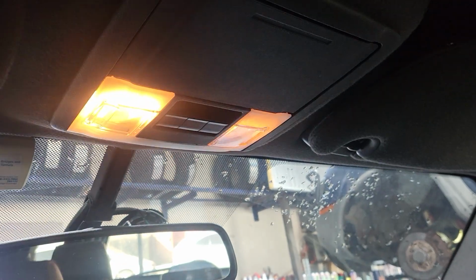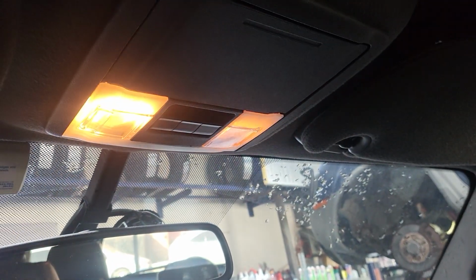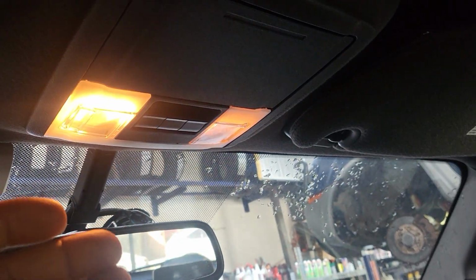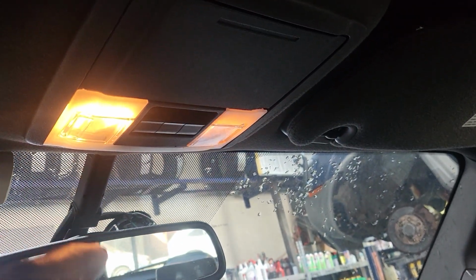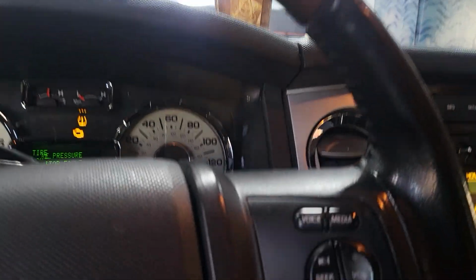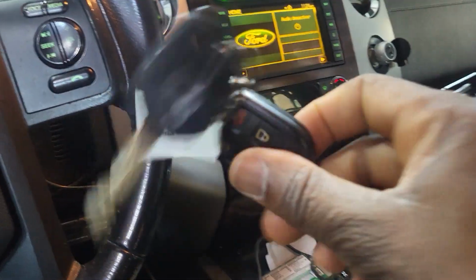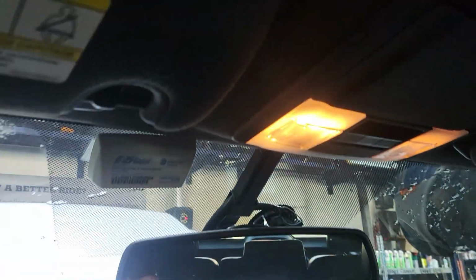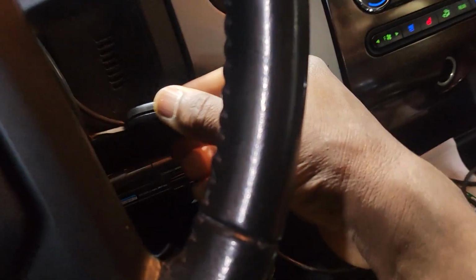The reason why is because either you did not finish the tire pressure programming, since the tire pressure sensors have to be configured into the new body control module, or two remotes must be working. In this car, we have one remote that works, but the next remote is missing. It will cause this one to blink all the time with the car running.